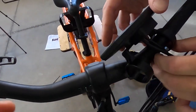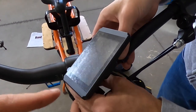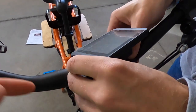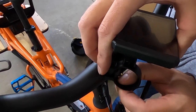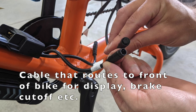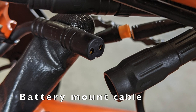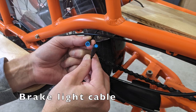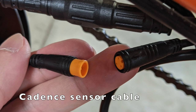Installing the LCD screen is probably the easiest part of the new controller upgrade. Just unscrew the existing cable and take off the old LCD. Attach the new LCD screen to the new mount provided before placing it on the bike — just be careful because the mount is made of plastic, so you definitely don't want to break it. After the LCD screen is hooked up, connect the cables at the controller. One thing to note: the motor power cable needs to be about an eighth turn offset from the arrows, as noted in the documentation from Bolton E-Bikes.